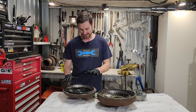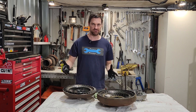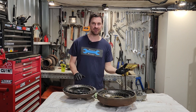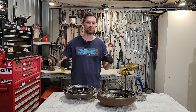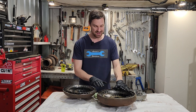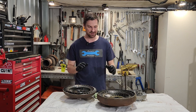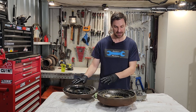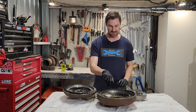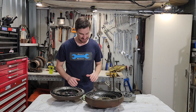Lastly, we have the impeller clutch. The idea is that it allows the engine RPM to stay high while the impeller slows down as required. This is typically needed on a front-end loader approaching a pile of dirt — you want the engine RPM for hydraulic breakout force, but you don't want to spin the tires. The clutch modulates how much drive the impeller gets from the engine, allowing full RPM for the hydraulics without spinning the wheels, because the impeller slips inside the housing. This particular torque converter has none of these three features — it has a fixed impeller, a fixed stator, and a turbine without a lock-up.